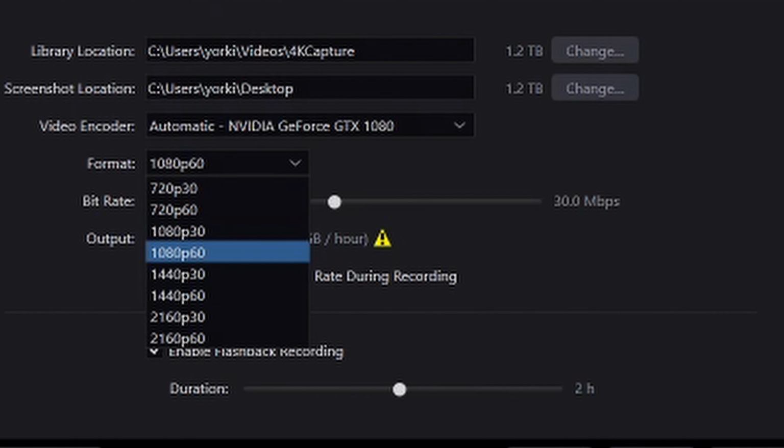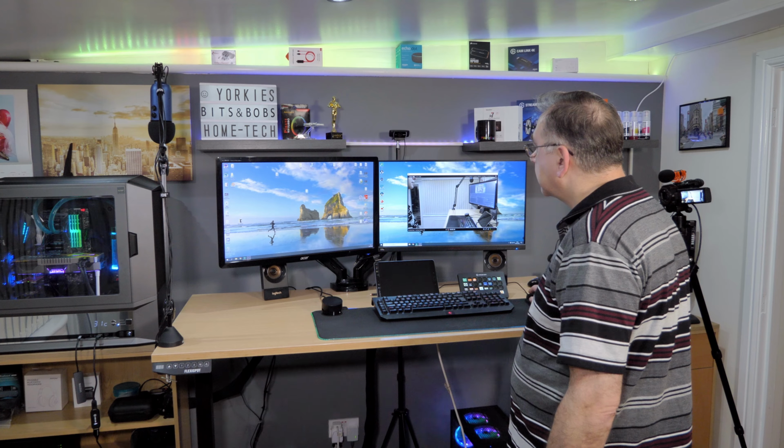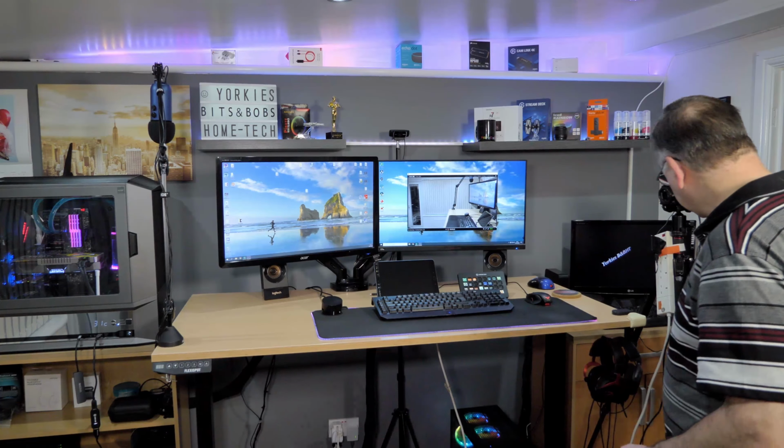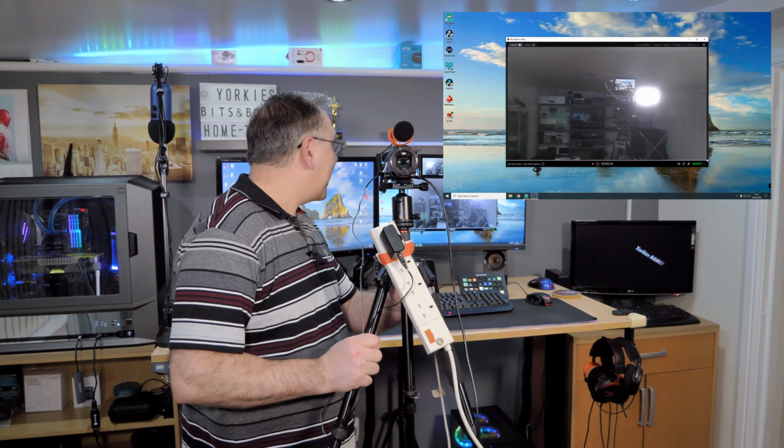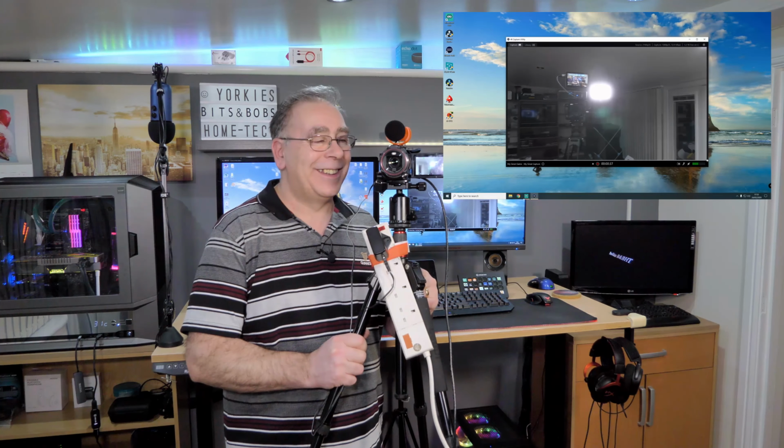That is how easy it is to get to work. So mine's working fine, as you can see. Just to prove that it's working, I'm going to move it about a bit and show you what I can see. Can you see that? Yeah, great big camera looking at me. So that's how easy it is to use. It's quite easy, but like I said, the software is a little bit buggy. You need to change your settings either in the camera. If you're not getting a picture, just restart the software, restart it once you've got everything plugged in. If you still don't get a picture, go into the settings and reduce your frame rate and your resolution, and keep going down, restart it, start it up again, and then it should be fine. But if you go too high, you will not get a picture.